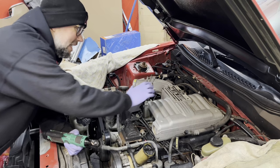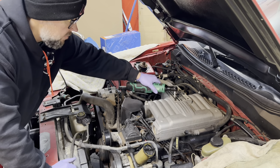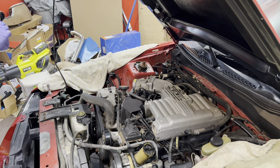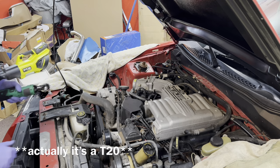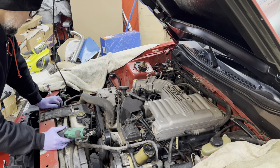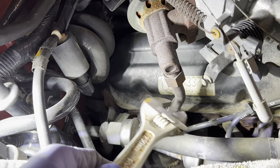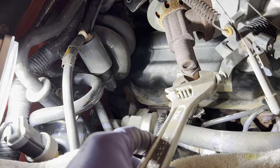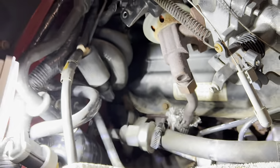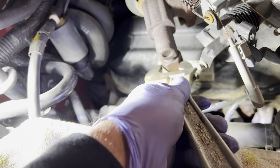For the pull I'm going to take off the upper intake manifold. It looks pretty easy - just a few big bolts and then you've got to get a cover off to expose one or two last bolts, which takes a T15 Torx bit. I've already got the accelerator cables off and some other clips on the side. The EGR valve pipe I was just going to cut, but I gave it a shot and I can't believe it - after 30 years it actually broke loose without any penetrating lubricant.